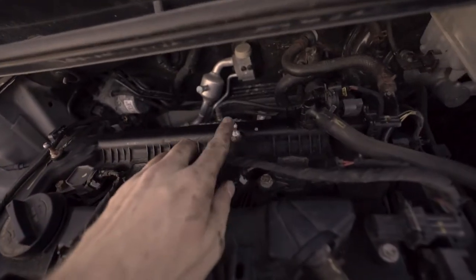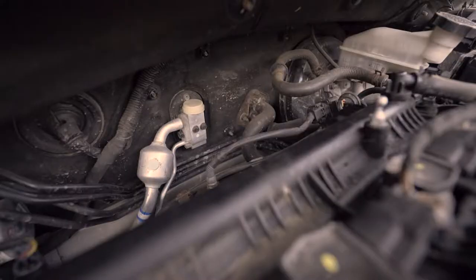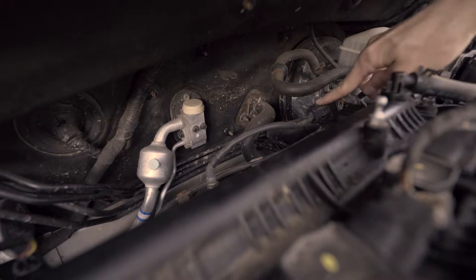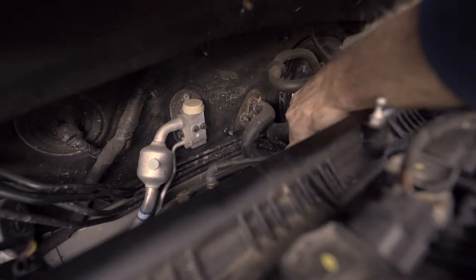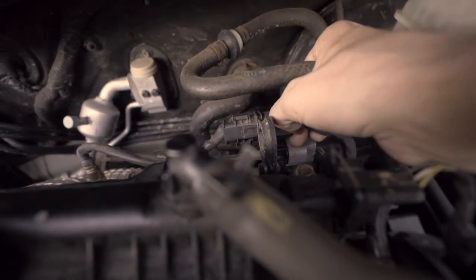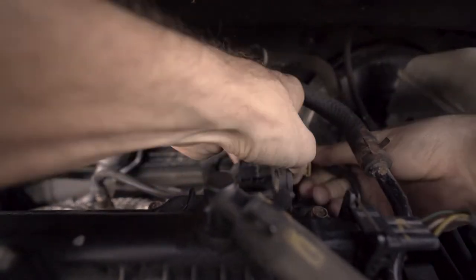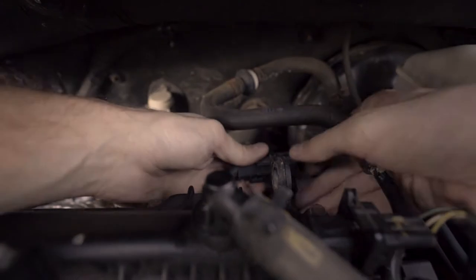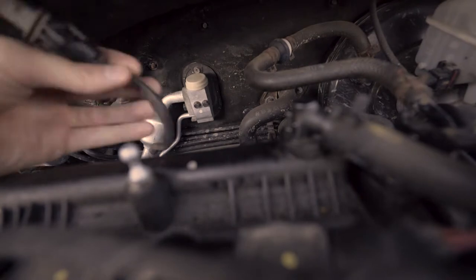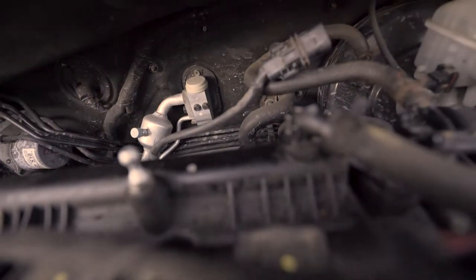Four spots — it's that easy. First thing you gotta do is take the O2 sensor and pull it out of the clip right here. It just slides outward. See that yellow clip? You have to slide that outward — that will allow you to unplug it. It may be a little stuck, but just pull up and it slides out of place.